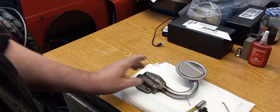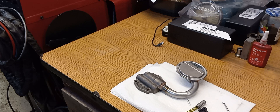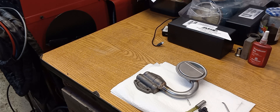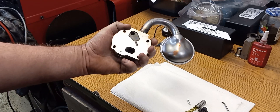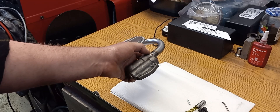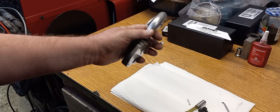I adjust the height from the pan to the pickup screen, and I use simple old Play-Doh. The bag the pump comes in — I put it over the screen so you don't want Play-Doh getting stuck up in the screen. Once I adjust it I mark it, then I braze it on, wash it, blow it out a couple times, and we're going to put her together.